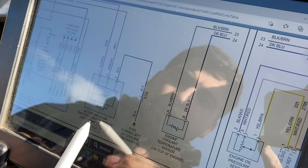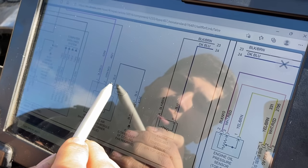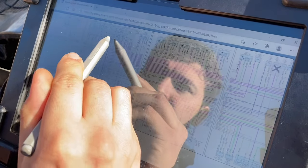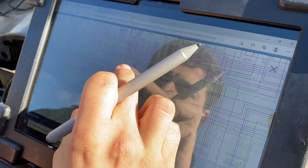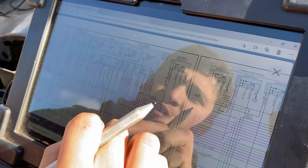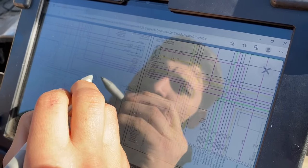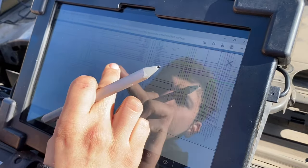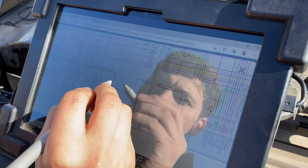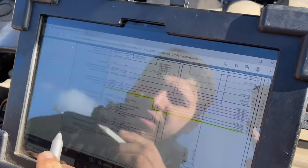My logic active grill air shutter one module. Very simple. The black wire is obviously our constant ground, and the violet wire — yeah, if we look at it, let's click on it. We want to look at the powers and grounds dynamically for any voltage drop, because that's when that would occur, not static. It's a 15 amp fuse there, and that's what feeds our power. The green wire here goes to our PCM — engine control module — all the way back.